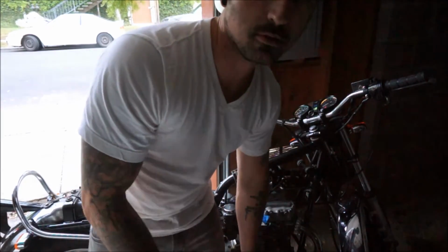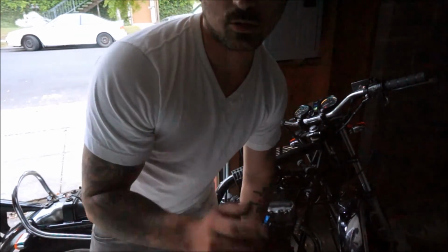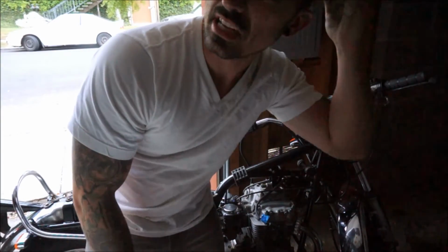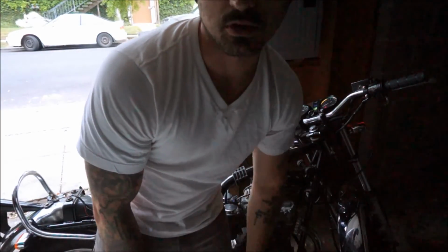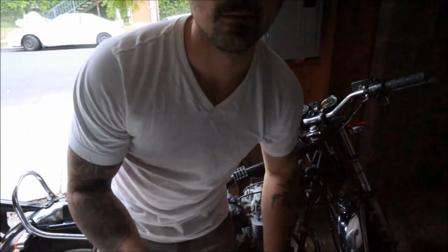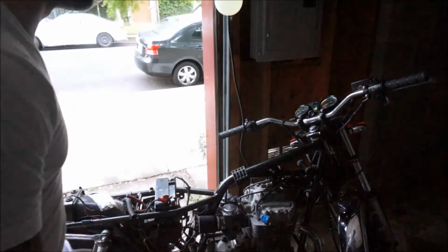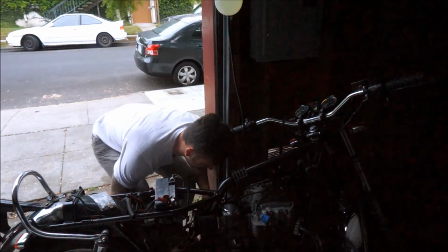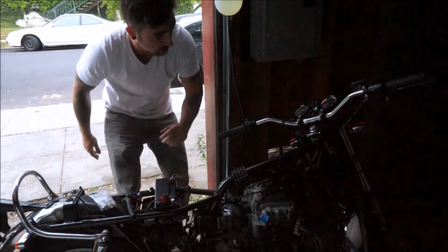Yeah, so drilling out the pilots to a 1/32, that worked really well, or whatever I said in that previous video. Yeah, if you got a KZ400, KZ440 and you're running pods and stuff on it and you don't want to use the airbox, you got to do that, because now it runs pretty good. It still needs to be messed with a little bit with the air fuel mixture, but I mean, you hear it, it's good. It's definitely hot on the cylinder now, which is good.